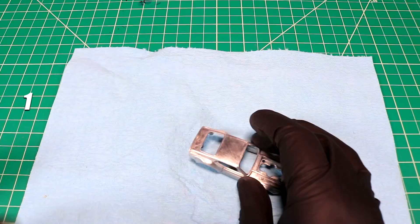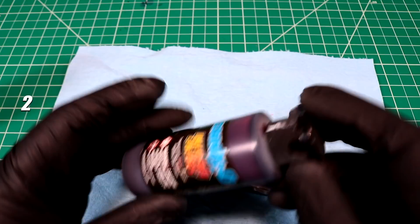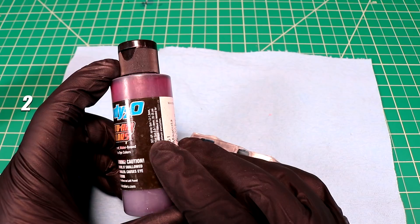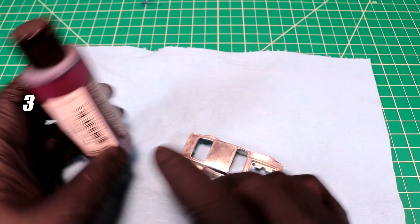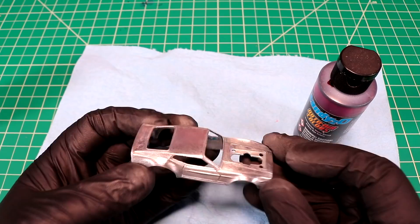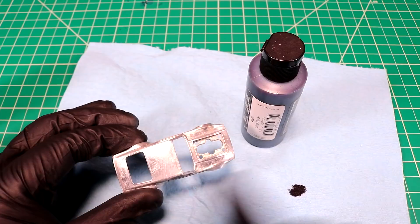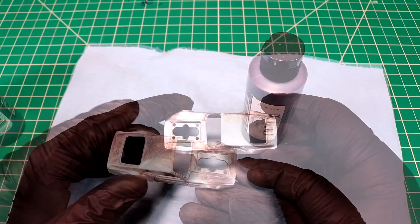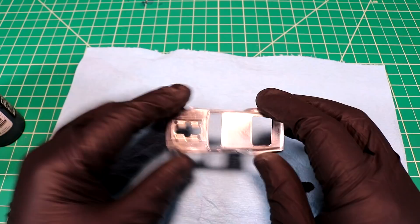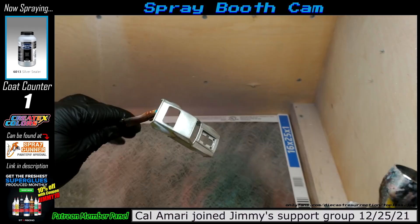First we're going to put on a layer of silver sealer, which is basically like a primer that has a ton of silver sparkles in it. Then to push the boundaries further we'll do a coat of this hot rod sparkle spectrum - basically just more flake. Then I'm going to take my sunset magenta - probably the brightest pink I could do - and if I just do one or two coats it'll be super bright. So we'll have our car hot rod sparkle, bring in this magenta with a super light coat to paint all these sparkles pink. Once all the sparkles are pink, we're going to bring in this ultraviolet and do just enough of a coat to cover it so it looks blue. I'll head over to the spray booth and we'll give this a shot.